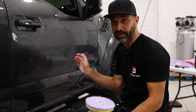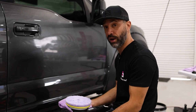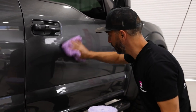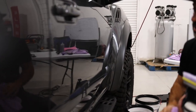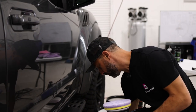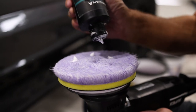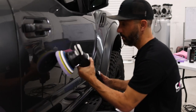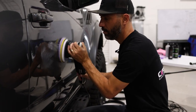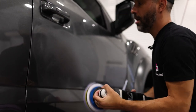In most cases, four passes as I just did there is usually enough to remove surface scratches caused by washing the vehicle, improper washing, or running it through a car wash. I like to take a look at my work — I started to have an impact here and it's nice and shiny, but that's just the first pass. Because I have some deeper scratches there that I'm trying to solve, I'm going to go ahead and add some more liquid and rub it on the surface.